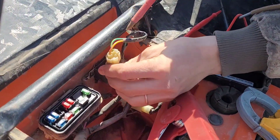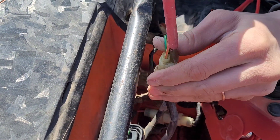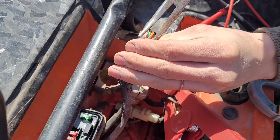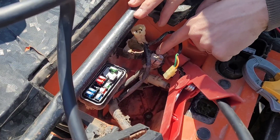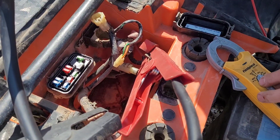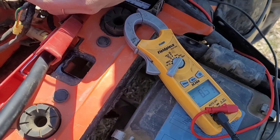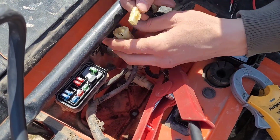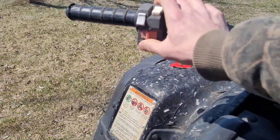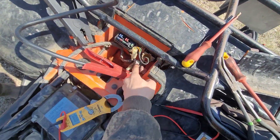To unhook this connector, there's a little piece you've got to push out and pull up to get it off. And right here you have to flex this little clip out before you can unplug it. To figure out if it's actually the switch or the starter solenoid, we check for voltage across these two pins. When we press the starter button, you can see we're getting 12 volts there. So the starter solenoid should be closing, but even with this plugged in and pressing the button, we're getting nothing. As far as we can tell, it's actually an issue with this solenoid coil.